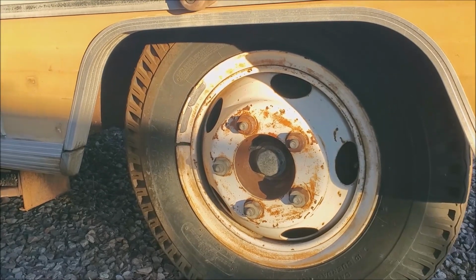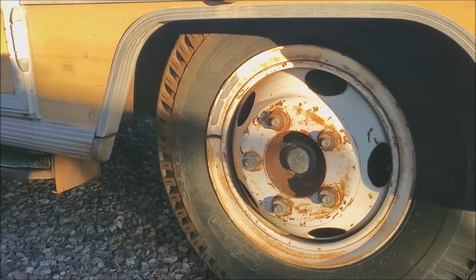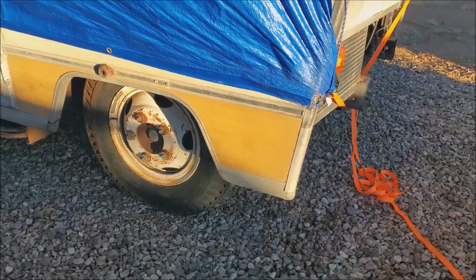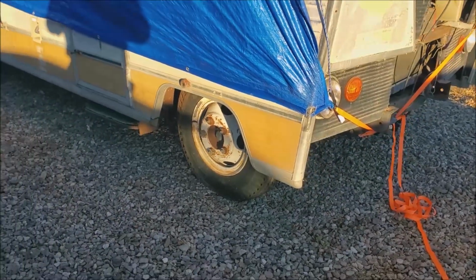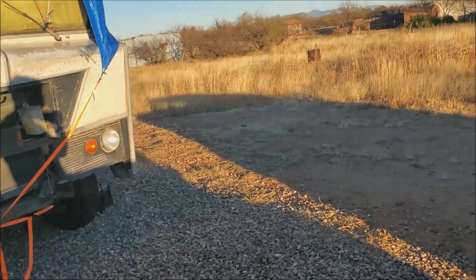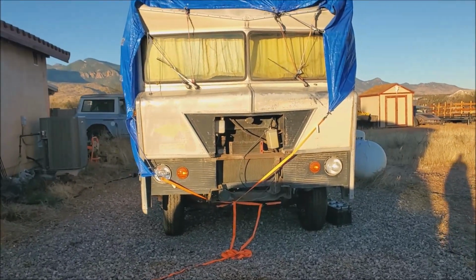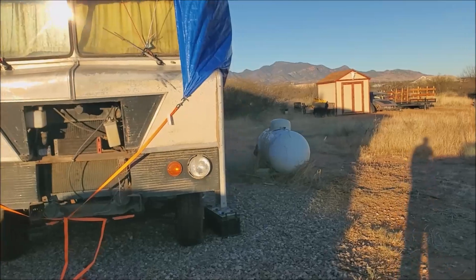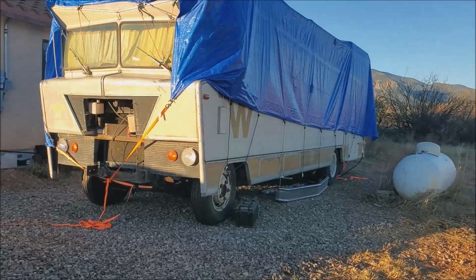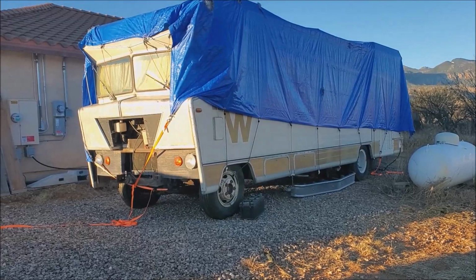So the other thing we got to deal with on this is it's got four-wheel drum brakes. When they're working great, that's fine. They say this thing will pretty much put you through the windshield when you stab the brakes with just the four-wheel drums. The problem is that parts for them are unobtainium. They've been obsolete for 20 or 30 years, maybe even longer. So it's great when it works, but when something breaks down, you simply cannot get parts easily. Almost universally, you end up having to find someone parting one of these out to get brake parts for it. So that's not cool.